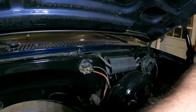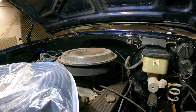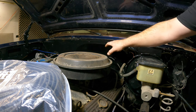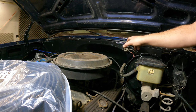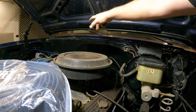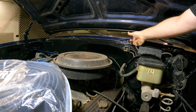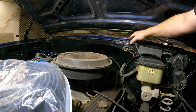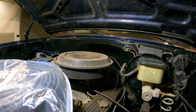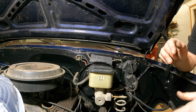Now, I don't know if you guys have a Chevy or not, but if you do, let me tell you a little something about the Chevys here. Normally, you have a hose that comes out of there for a squirter, and then they connect right about here with a Y, and then this one comes out. So it looks messy across here. So I ran the one down inside along the cowl, and the connector's right inside now, right here, which is still out of the way of the mechanism of the wipers. So now you just have one hose coming out down to the washer bucket. It just makes it a little tidier, if you know what I mean.